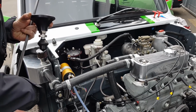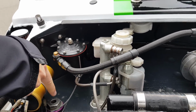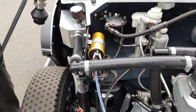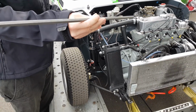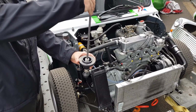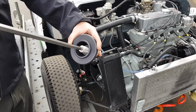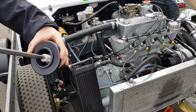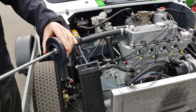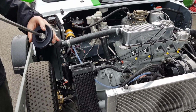So what you do is you can drill the tower bolt. You see the tower bolt just there. You drill a big hole through the centre of the tower bolt. You also drill out the donut, the suspension cone. Get a section of hex bar, and it's a bit of a fiddle, but you can pass that down through the centre, and there's a hex adjuster in the end, and then you can wind that in and out. Nice and easy then, really. It's a lot easier, and you can do that on the rear on these race cars. They don't have a valance fitted on the back, so you can do the same thing at the back and adjust it in and out, and that means you can adjust all the corner weights in situ rather than upsetting the suspension.